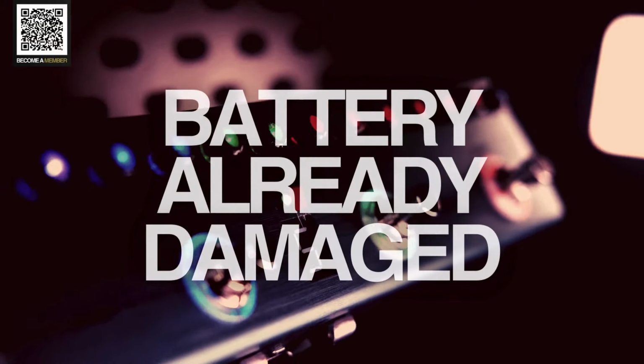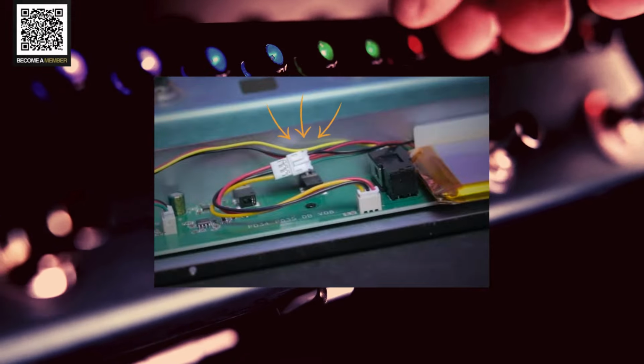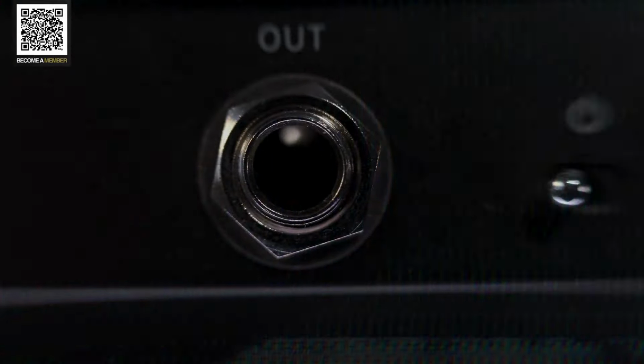But what if the battery is already damaged? You can simply detach the battery by removing the battery connector. It will enable the usage of your Tank G only with the USB-C power supply on, which is not a perfect solution, but could be a mitigation plan until you have a replacement spare battery.